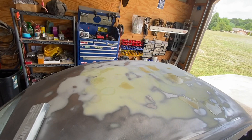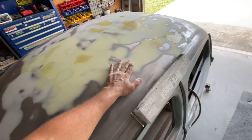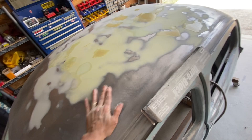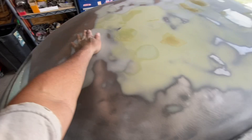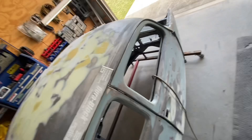I'm back and I'm almost done with this roof. Using 120 grit right now and it feels really really smooth. I just got a couple of spots I need to rectify — one here, one over there, and one over there — but that's it and then the roof will be done for now. Then after that we're gonna clean it. I'm gonna go around the whole entire car. The door is completely done — had a couple of low spots but now it's done.